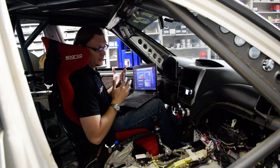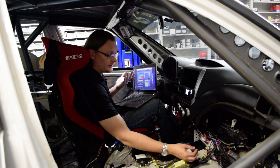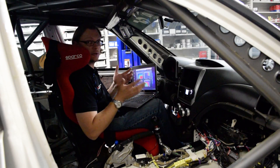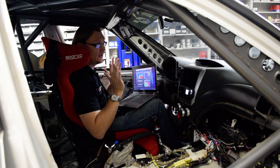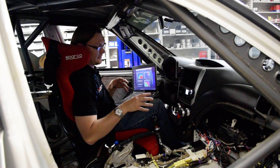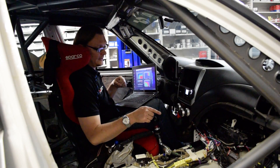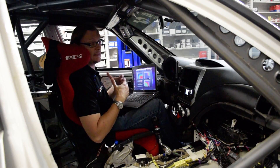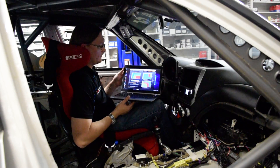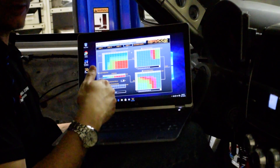Like some other controllers, this has a manual feature. There's a dial already on the controller — if you're in manual mode, that's your center diff control, your center diff lockup. There's also an auto feature where you can basically tell it to look at all your accelerometers and just do whatever it thinks is best. One of the things we really like about the MAP DCCD controller is it also has four preset channels. You can select through those, and with those four preset channels there are actually 10 maps that you get on the controller. When you plug in and connect a computer to the controller, you can select which four of those 10 you load onto the controller.